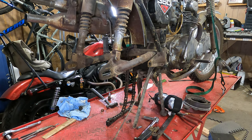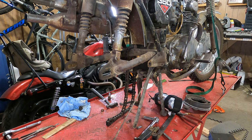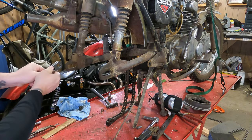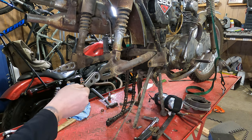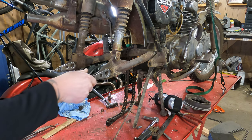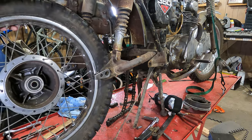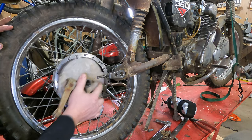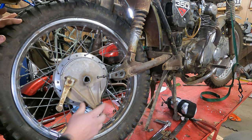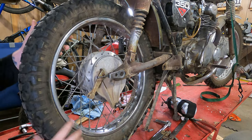Now for rear wheel reinstallation. We have our axle adjusters — these technically just slide on and off the swing arm. Before I put them on, I like to squeeze them in just a wee little bit so they stay in place on the swing arm. This is not necessary but it's a nice little bonus. Next, get our rear wheel up in place, then take your brake drum — make sure it's clean of grease — and reinstall that into place. Now would have been an excellent time to clean this off, which I didn't do. Then we'll roll this up into place.